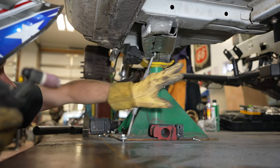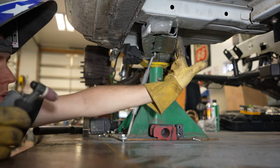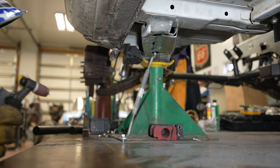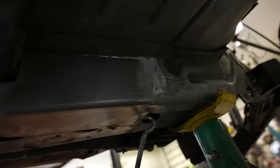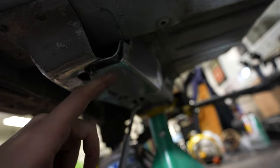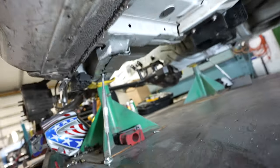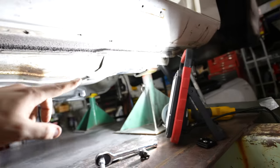I might add a little more weld to that because there's not much there. I'll add one more — make sure it's tight up in here. As long as that's the case, I can put the bar in, tack weld it all up, and then come back and cut the tacks, release it, and let it drop. First piece is tacked in — we're pretty tight, yeah. A little gap here and there but this should work; it's pretty tight most of the way around. With stock body panels and stuff, trying to get everything 90 to 95 percent tight is not too bad, as long as the welds will hold it.